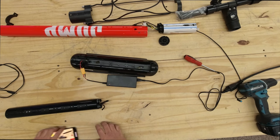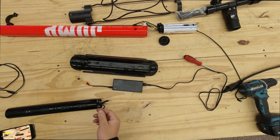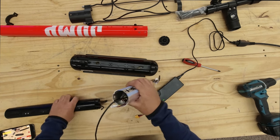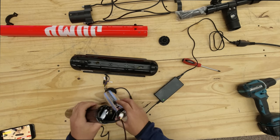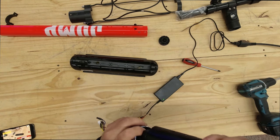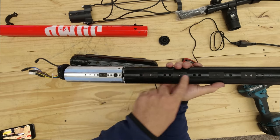5 minutes. So it's been about 5 minutes. Now let's check to see if we can wake these batteries up. They should have some charge in them now, enough to recognize them and just do its thing. So now what we have to do is reconnect this internal one, right? The BMS cables first, and then I'm gonna push that little plug in there. Then you shove in the cables. Yeah, one way to know that you're doing it right is these screw holes are on the same side of the connector, right?